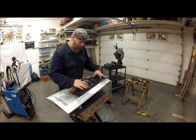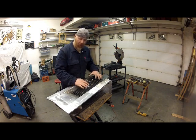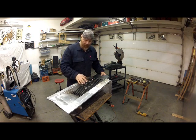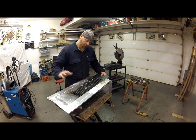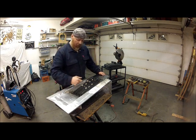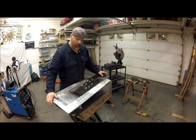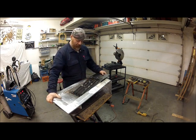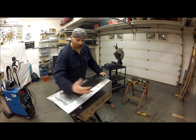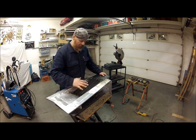So I built a stomp grate for it. Keep in mind this is upside down — normally the rocks would fall out this way, not into the jet. What I would do is, if I picked up a bunch of rocks and started losing power, I'd stop the boat out in deep water, pull a lever, and this grate will lift up and pivot on this hinge here, and the rocks fall out — just like that. No more taking my shirt off and reaching up under the boat.